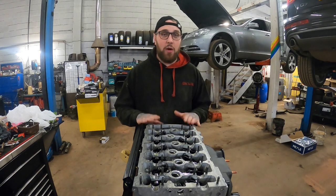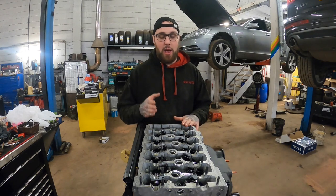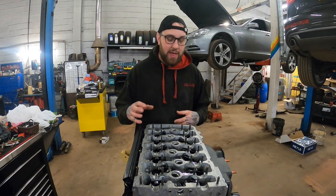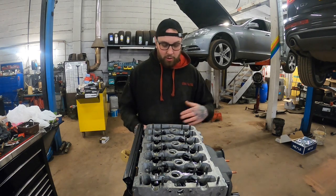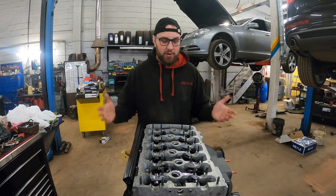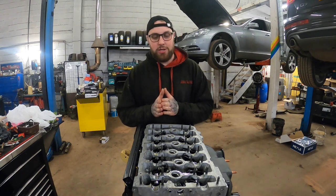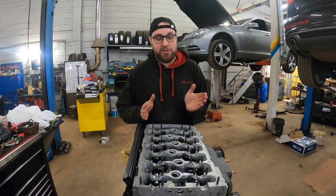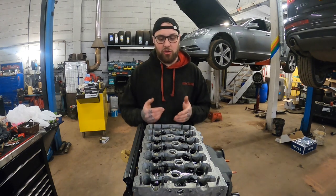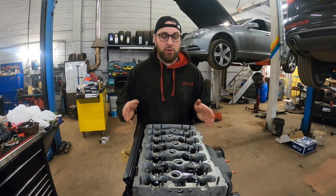For the valves, I was planning on just using the ones I already had. It wasn't till it went to the machine shop - I had to move on the machine shop - that's why I haven't covered much on the head. They did a really good price on a head refresh. Lapping in valves is a tedious job. On a budget build you don't necessarily have to lap them, but I wanted to because it's done 100,000 miles and I wanted the seats to be perfect.